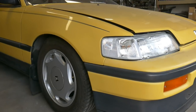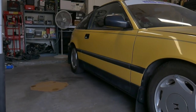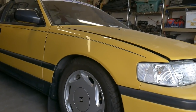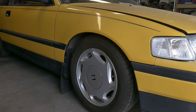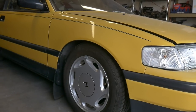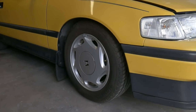A lot of these parts are going to get transferred over to the CRX now. So we'll have the new bushings in the front lower arms. I might change the Blackworks arms and put those Hard Race on there. And then the camber kit I'll probably put on the front. I'm not sure if I want to go with that one or the Skunk 2. I don't really like the way the Hard Race has the bolts on top of the camber kit, not underneath like Skunk 2 — it makes it a lot more difficult to adjust when you take it somewhere to get aligned. So that might be the only reason why I go ahead and get the Skunk 2 instead.